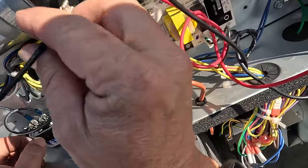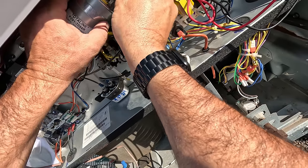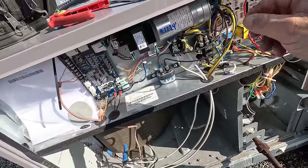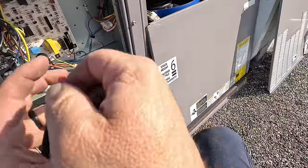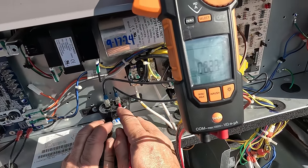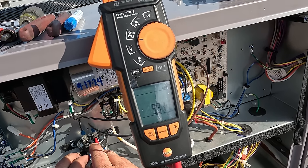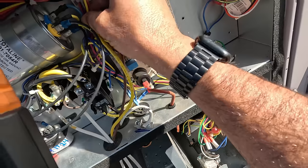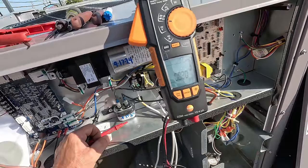Come over here to the fan one. Putting them in parallel adds up; put them in series and it makes them go down. I don't know the mathematical formula for the series one — it's not very often I've done that. So now let's recheck it. We're going ahead and unhook the fan from it, that way we're checking just the capacitance of the capacitor. So we put it on there and we see what we come up with — 9.91. So not exactly 10 like I'd like, but well, that's your high quality operations there.